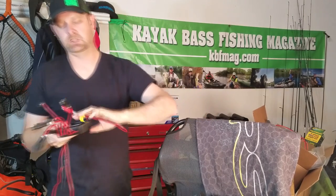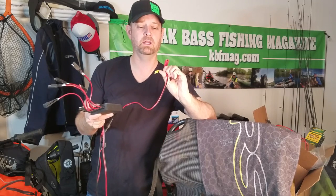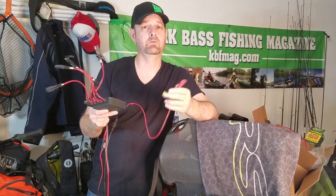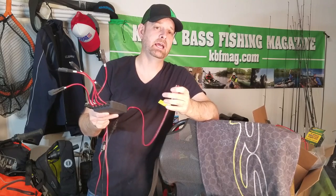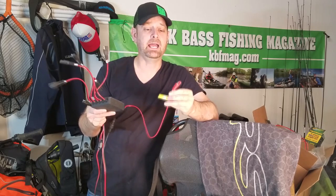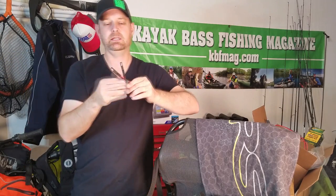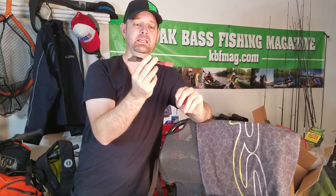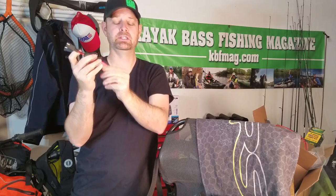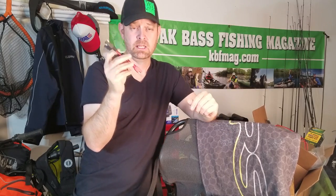If you're using the big switcher box, it's labeled for power — a red plug instead of black so you can see the difference. This says do not use more than a 15 amp load fuse. If you're running an inline fuse, look at what your item is rated for: 1, 2, or 3 amp — run that fuse on that line. If you're using something with a heavier draw, account for that, but do not put more than a 15 amp fuse in line. There's also an SAE plug splitter available if you want to run multiple things — like lights front and back — all on one switch.